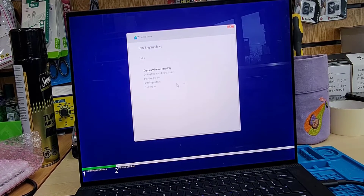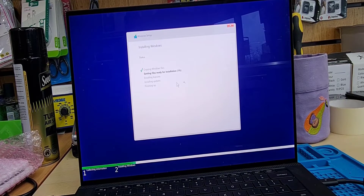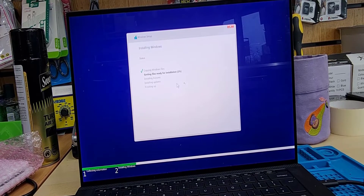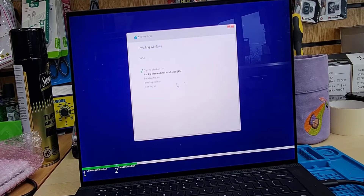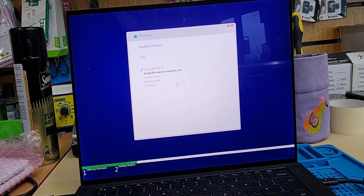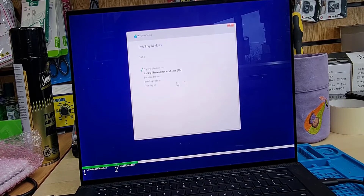So if you have this sort of issue — device not found — first of all, check if the SSD is physically properly connected in the SSD slot. If it's connected, then try to troubleshoot the Windows system. And if that still doesn't work, the last option would be to replace the SSD. Once you replace it, you'll need to reinstall the system via a bootable USB thumb drive. If you don't have one, you can check my other video — the link is in the description. If you have any questions, leave them in the comment section. I hope to see you in the next one. Bye for now, thank you.